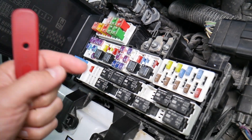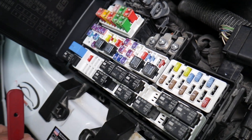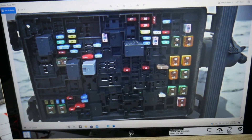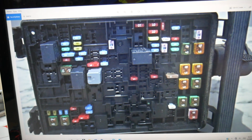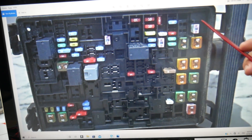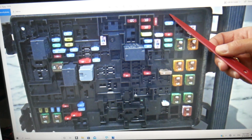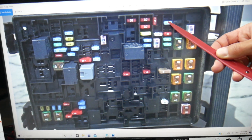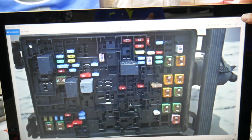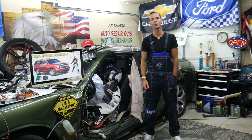We'll put a link to a special video that will teach you how to test fuses and check relays very easily. So check it out — it will be in the description below. For the exhaust solenoid, we need to first check one fuse. If you come to that row of fuses, even if you have a missing fuse, count the spots: that will be fuse 20, 21. Fuse 21 — that 15A fuse — is the one you need to check. As for a relay, you don't have a relay; this fuse is known as a relay fuse. If you have problems with the exhaust solenoid, check this fuse first.